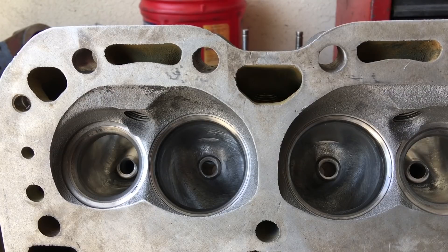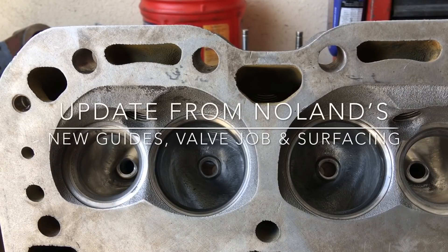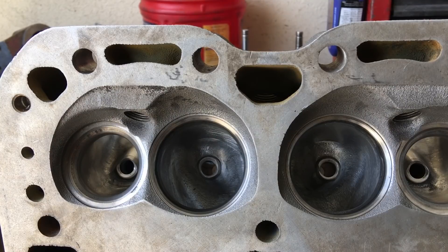I just wanted to throw this all on video before I took it to Nolan's to find out exactly what all we're going to have to have done to make them 100%, because I want them to perform without issue. If you've got excessive valve guide wear and you're revving an engine, you could pop the end off a valve easily, especially if you're running two-piece valves. If you get a valve that's wiggling or wobbling at RPM, all it takes is the right amount of heat and just a certain amount of pressure in that tulip - the big end of your valve can snap off.